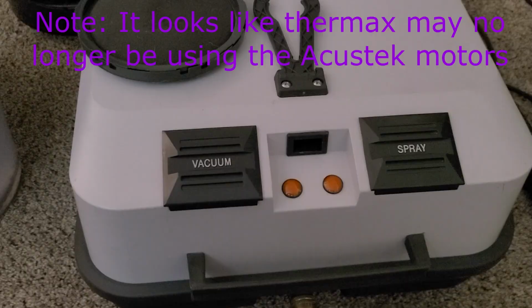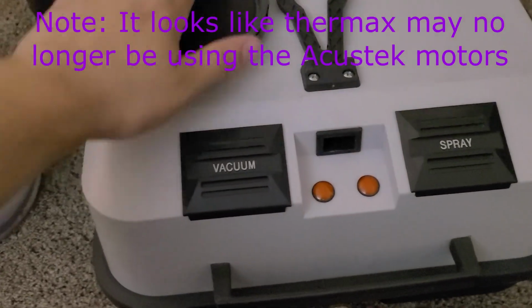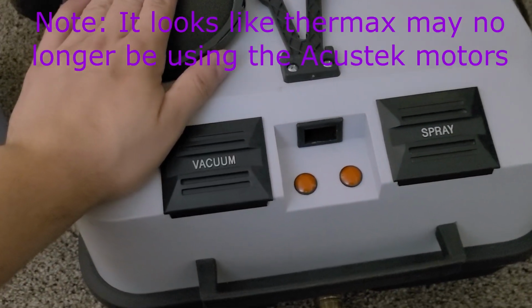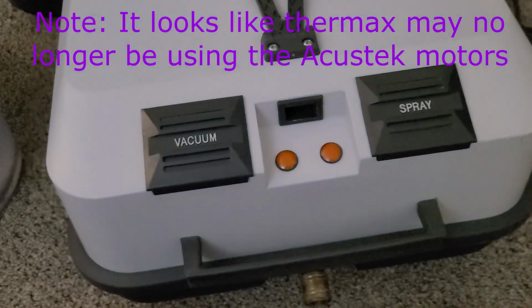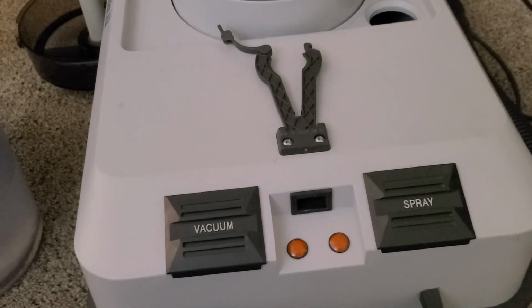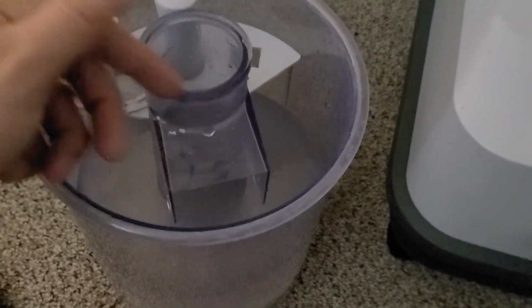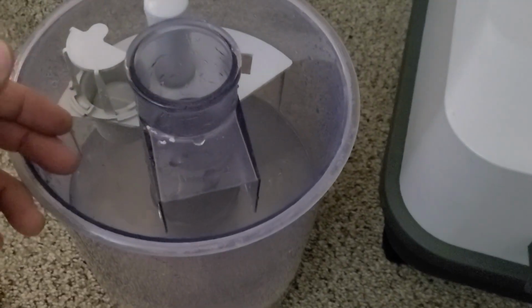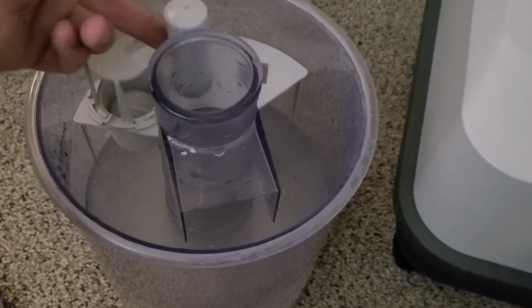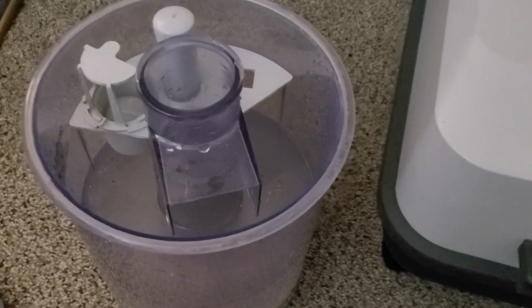And I know it's not super powerful, because I think it's only rated for about 95 CFM. Something like that. But when you're dealing with water machines, especially baffle style machines, there's kind of a balancing act, because if you have too much airflow, I believe that's going to cause the water to come out a little bit more violently, and you're going to end up with more of it getting through your system and possibly into your motor.